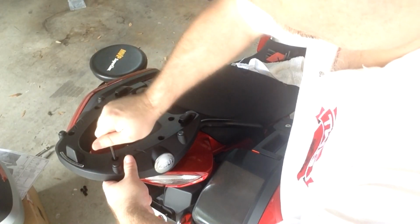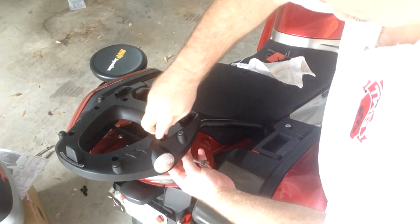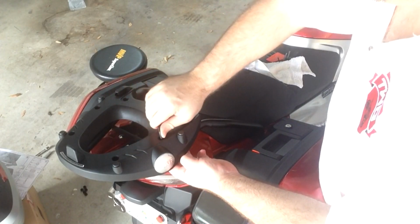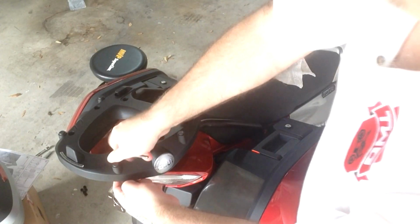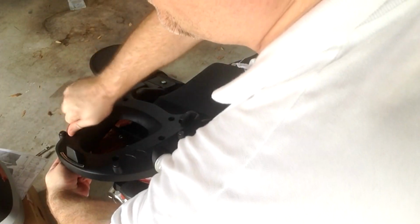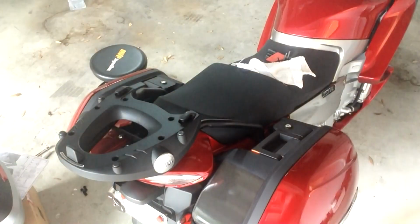Now all these guys, snug them up, don't torque them all until they're all fairly snug. And these just torque down 6 or 8 foot-pounds. Nice and tight, but you don't want to even try to strip out these little nuts. Okay, this is not going anywhere. This shouldn't be as tight as you do a spark plug, for example. Just real good and hand tight.